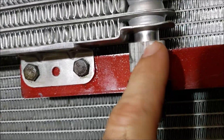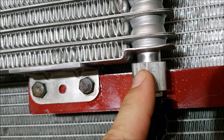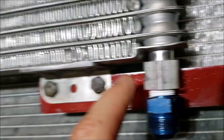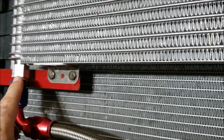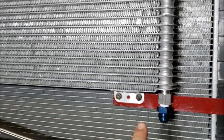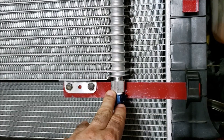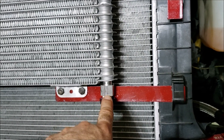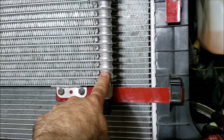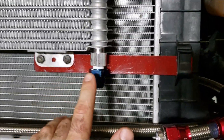When people say 'you idiots just put metal flakes in there' — no, we didn't. As we drilled, we put an air chuck on this side using a quarter-inch to three-eighths adapter, keeping constant positive air pressure going in so all chips blew right out the other side. We never drilled without positive air pressure blowing chips out. We also wire-brushed the inside and ran a reamer through it — all with positive air pressure — to avoid contaminating the new cooler with metal flakes.